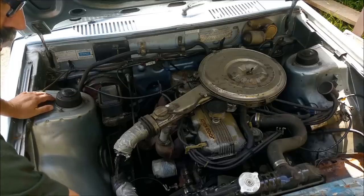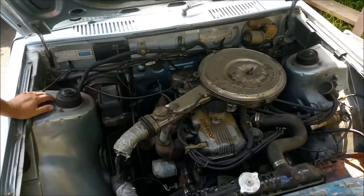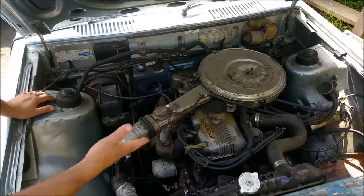We've got to do this - we know about the radiator support. The battery tray has some corrosion and two welds that have lifted off, so I'll drill out the other ones and do some welding repairs on that. This is all dependent on the engine for now.